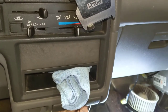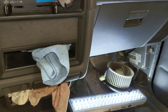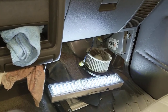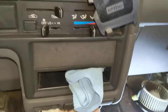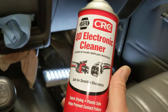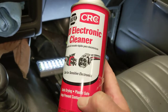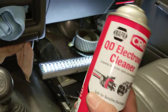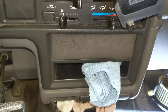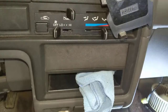I'm going to show you three things for this heater blower motor. I'm going to show you how to put that motor back in without taking everything else off, and I'm going to show you how I fixed this switch. I've got this plastic-safe contact cleaner — I got this at Napa, it's CRC — and all I did, the thing that made this motor start running again on multiple speeds, was getting these contacts cleaned up.